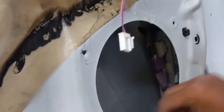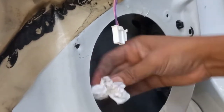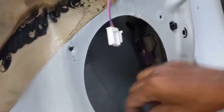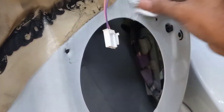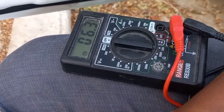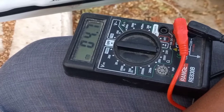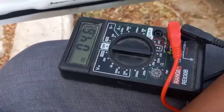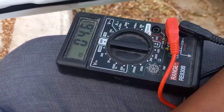This is the contact area for the pickup. The metal is about 3mm. The resistance of the speaker — impedance of the speaker — in the 200 ohm range shows 4 ohms. So I am replacing the 4 ohm one-way factory speaker. The new speaker is a 3-way Pioneer, 4 ohms.